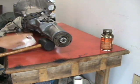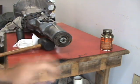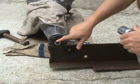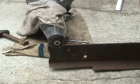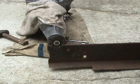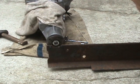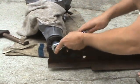Now this guy's going to be torqued down, and I'm going to get it set up on the ground with my bar assembly on here so I can torque this nut down. Okay, now we're going to torque down the flange nut. In the Haynes manual, I couldn't find it in the MGB workshop manual, the torque spec on it, but in the Haynes manual, they call it the drive flange, 150 foot-pounds of torque. Now what I did find in the MGB manual for the automatic transmission flange, 50 to 60 pounds. So I'm going to go with 150 foot-pounds of torque to put on this guy. So we're just going to crank her down.